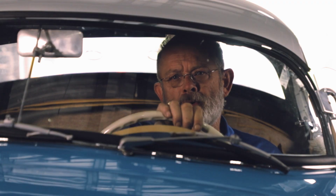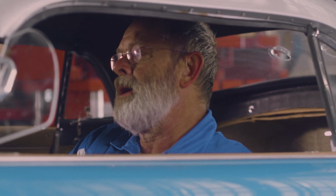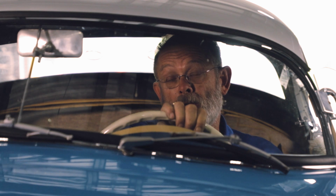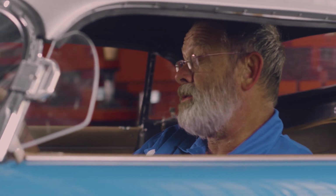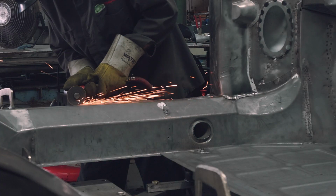We also are in the process of making the windshield frames for this car. That will be out of extruded brass, just the way the factory made them. We have the windshield posts made. We also have the folding tops for the low bow and the high bow Speedsters, and they'll be fitting to the cars. If someone is restoring their Speedster, it all depends on the condition it's starting in. You could have a rusted out hunk that could take a restoration shop 3 years to do, or a mild restoration that could take 6 months. Our chassis is allowing people to cut that time in half.